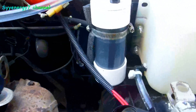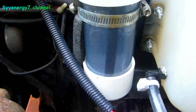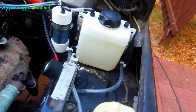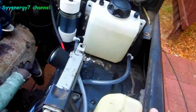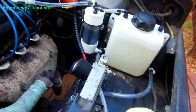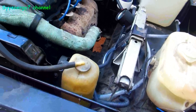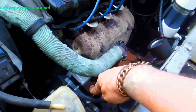Look at that production. They say half a liter a minute per liter of engine. I think this thing is putting out a liter — no problem. I mean, I don't think I'm exaggerating because that's like a 3/8-inch hose. It's putting out plenty for this engine. It's not too many amps — I don't have to do anything with the alternator. Another feature is that this is mounted to the engine, and that might be giving me more production.